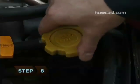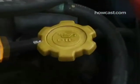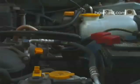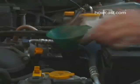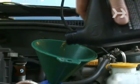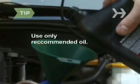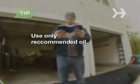Step 8. Remove the oil fill cap. It's usually marked with an icon that looks like Aladdin's magic lamp. Place the funnel into the opening. Step 9. Pour a quarter of the bottle into the funnel. Add the oil slowly so it doesn't go above the full mark. Use only the kind of oil recommended by your manual.